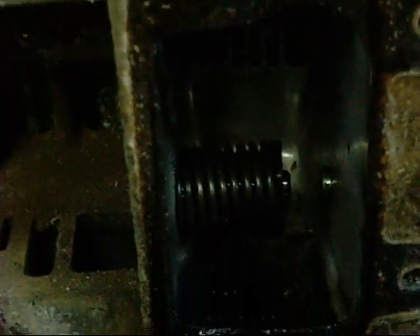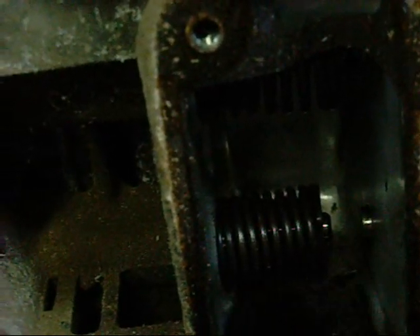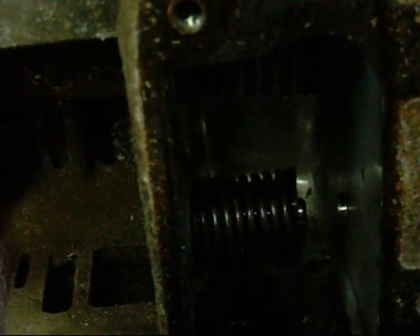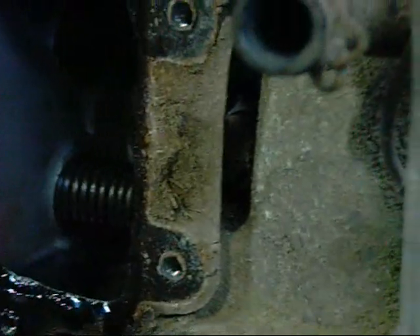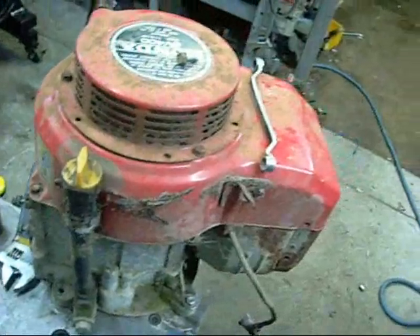It's pretty much what I expected — exhaust valve stuck open. I'll try and free it up without having to take the head off. Chances are water has just gotten down inside this muffler tube — it's all sort of homemade — gotten down inside there and just rusted it out. Well, this is definitely going to be a head-off job. As one thing leads to another, I'm going to take the head off and fix this thing. No use fiddling with it halfway and then putting it aside.